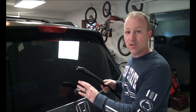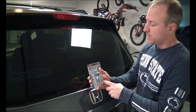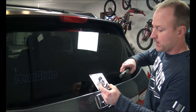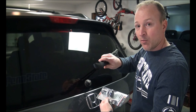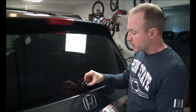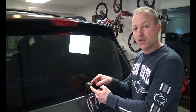The tricky part is you need a specific tool to help get this off. There are two different tools you can use. One is this windshield wiper arm remover — it's like a U shape, it clips around and will pull the wiper arm off. The problem with this one is it didn't work because the wiper arm was already off, so I needed something to get around the little threaded nut and compression fitting that's on there.